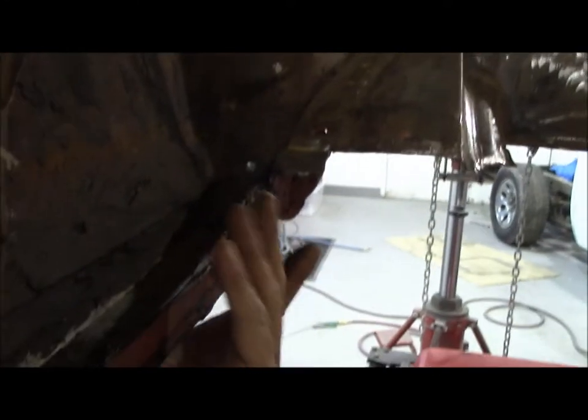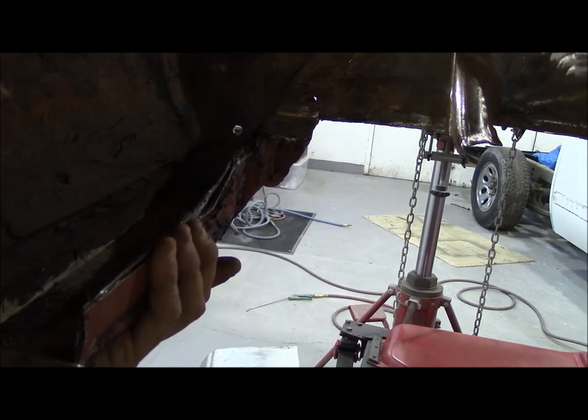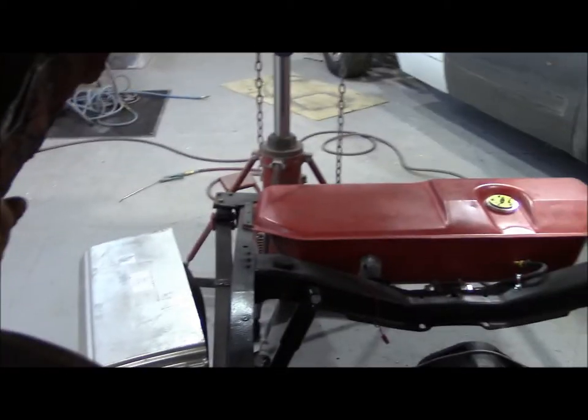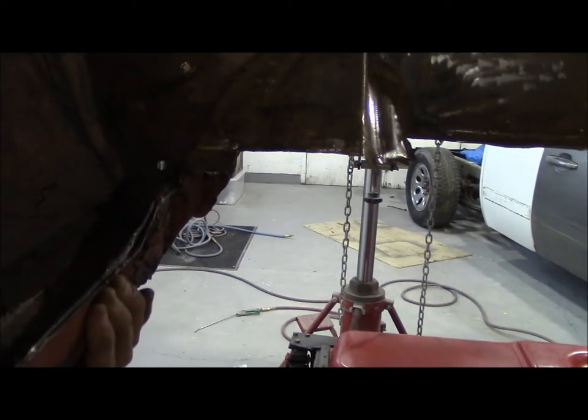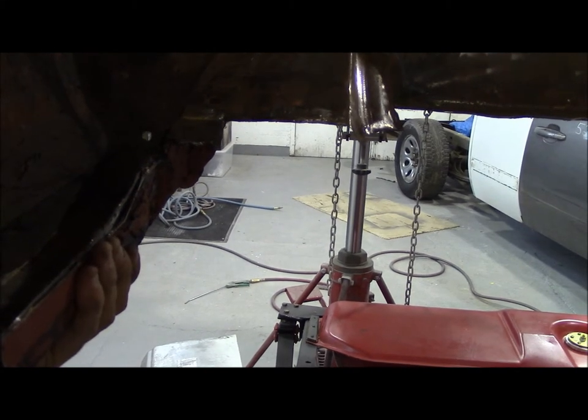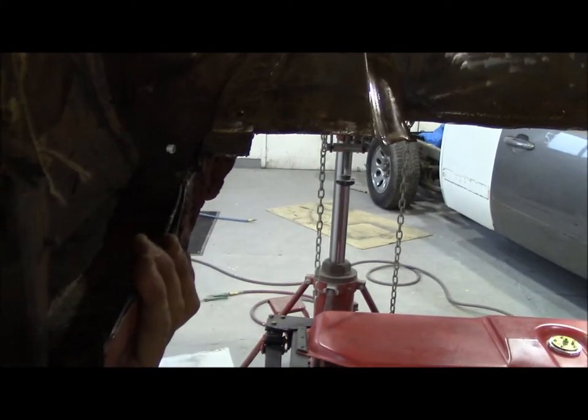What I'm going to do right now is cut this panel off because it needs to come off — there's a back side to it. You can sort of see where my hand is up in here — there's a back panel that comes along here and the floor butts up to it. Instead of putting this piece of floor in where this big open space is right now, it's easier to work on it now. I can stand in here or stand outside the car. Let's get this done, then move on to the floor panel.